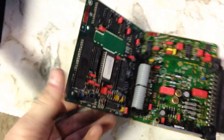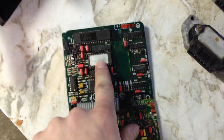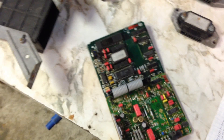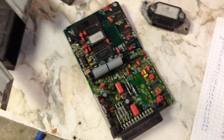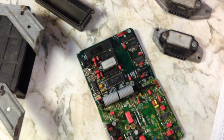If you're lucky enough to get an EZK that's chippable, it's great because it allows you to pre-flash the maps however you choose. It also allows you to emulate using an Ostrich or similar emulator, so you can basically tune in real time with your laptop — which is just amazing for something so archaic and old. That's the primary reason why I did this: I can emulate it and tune it with my laptop, which I find fantastic. I don't need anything else other than that.